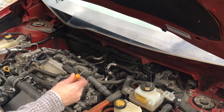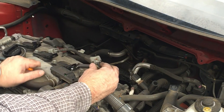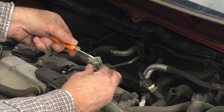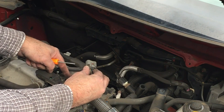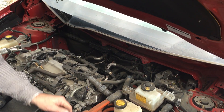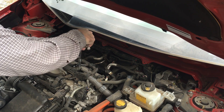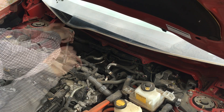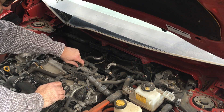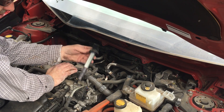I'm back to my small screwdriver. The way I'm doing this is sticking the screwdriver right in the front of this clip and prying it up so that the little piece that sticks out of the plug can come off. Now I'm going to take my 10mm and take these bolts out. Should be able to just pry these up with my hand and pull them out — and there's the coils.